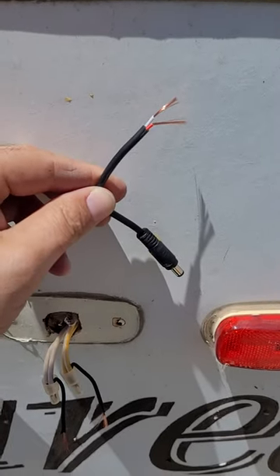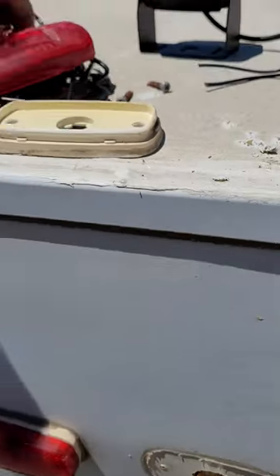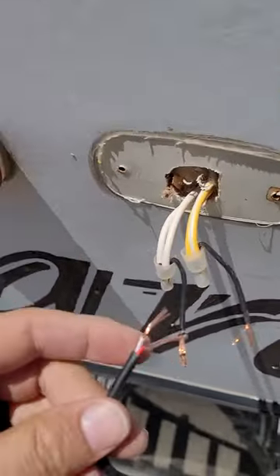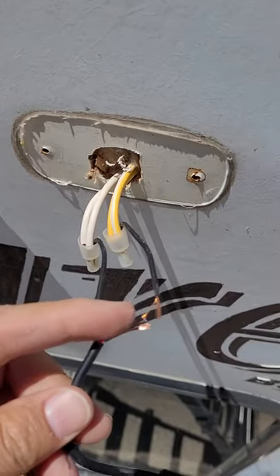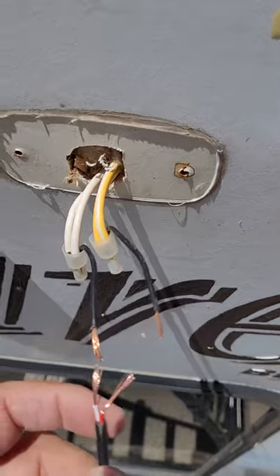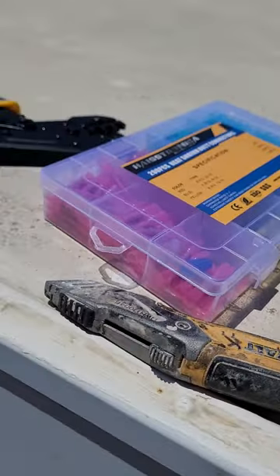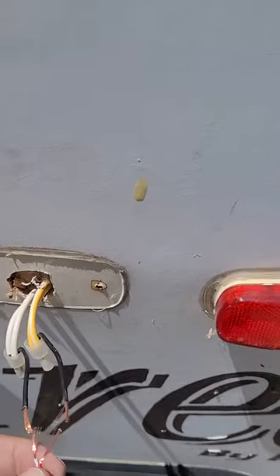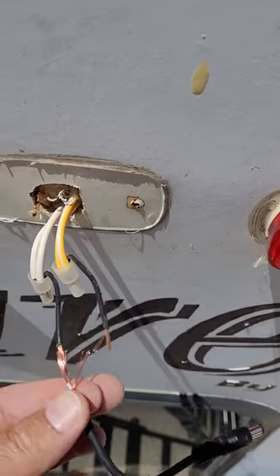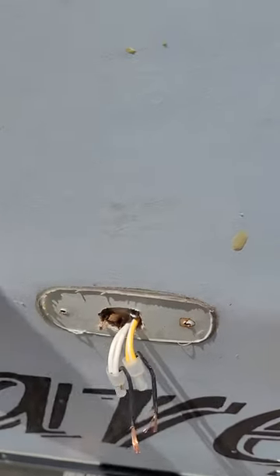This wire that came with your kit — I already spliced it; it was connected just to a longer piece of wire I don't need. You will hook your white wire to your white wire, and you will hook your red to mine, which happened to be yellow — that's positive. Then you will crimp those. I have a crimping kit, pretty cheap on Amazon as well. Do whatever you want — use a wire tie — just make it safe.